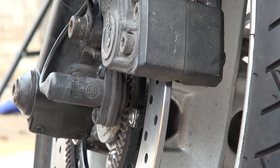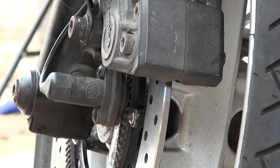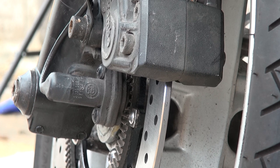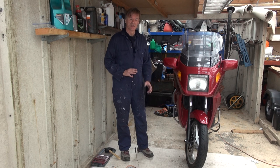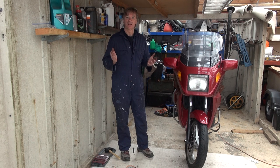The final check is to check the gap of the ABS sensor to the ABS ring — that should be between 24 and 26 thousandths of an inch. I'm using a feeler gauge and yes, it goes in there with a nice snug fit, so I'm happy the ABS sensor is set perfectly. I'll now reassemble the mudguards. The job's done — it was a bit tricky in places. I've used some disc cleaner to wipe the discs down in case of any greasy fingerprints. Thanks for watching; if you like what I do please subscribe — catch you next time, bye for now.